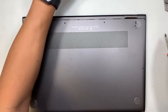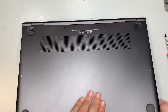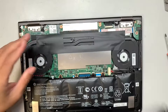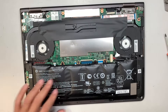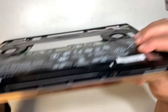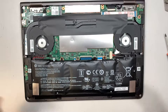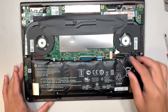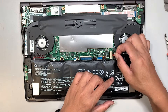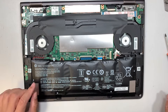Once you have removed those, go ahead and slide and lift up the back cover. Here you can see the battery is obviously swollen — very hard and lumpy. We need to replace it. This is the connector — what you do is slide the connector to your right, just pull it or slide it to the right to disconnect the battery.